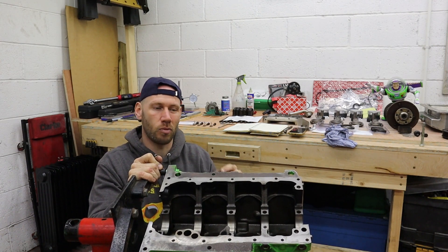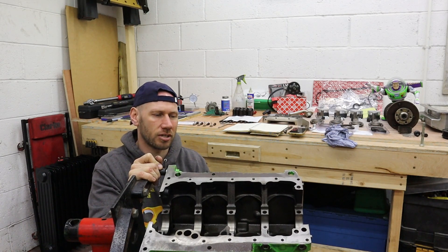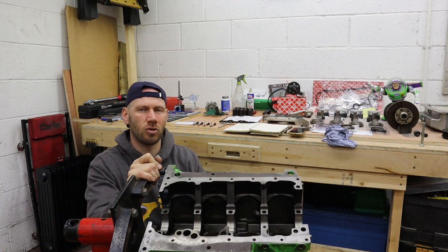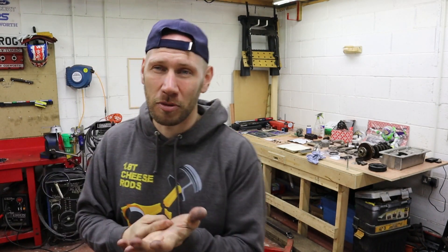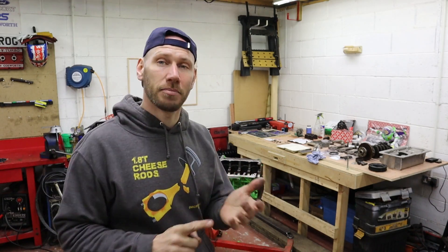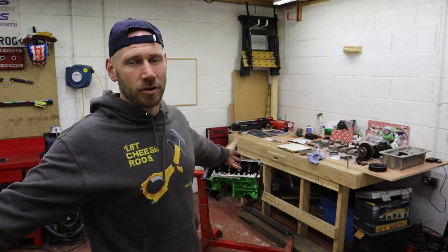Every single one responded exactly like number one — the five thou was just a little bit too slack and the six thou just couldn't quite get in. I haven't got a five-and-a-half thou feeler gauge, so my best educated guess, and what my build sheet is going to say, is five and a half thou. I'm happy with that. Bearing crush: done. So that's the engine block finished — really happy with that, a nice tick in the box. The bearings are a very fundamental part of the engine build and I'm happy to put this together now. Going forward it's going to be more assembly videos, so if you're into engine assembly, stay tuned. Thanks very much for watching — if you liked it, hit like and subscribe. See you in the next one!